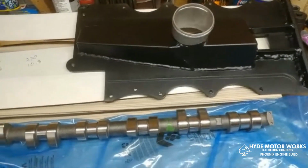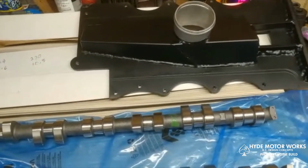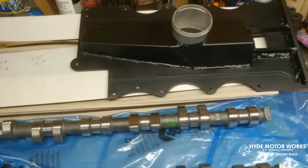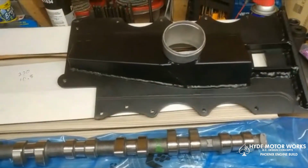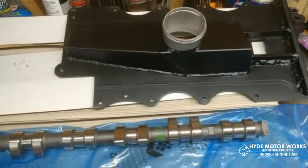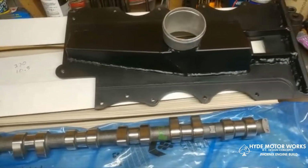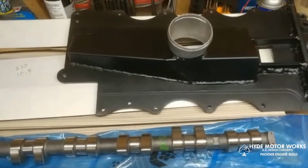I should see a slight pressure drop between the supercharger and the intake manifold while it passes through the intercooler. When you cool the charge temperature down, the air is more dense, so there should be a little bit of a drop, but it should not drop a tremendous amount, especially at higher RPMs and higher airflow. I should see a pretty steady pressure differential.